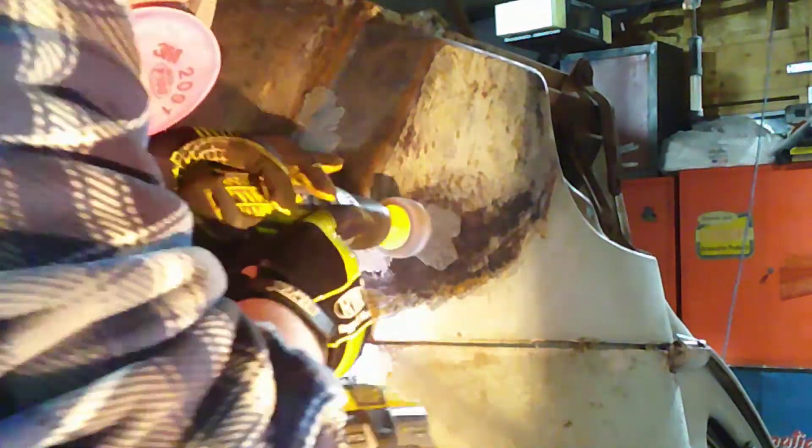Right here I'm trying to smooth things out and bring it down to a nice level where it's still bonded to the steel. Of course I'm not going to get to the original thickness of the steel — that would take a lot more time. I'm pretty happy with the way it turned out after all the sanding — you can already tell it's blending a lot better and finished up pretty nice. I did try a different brand of the similar product — I think I started with Permatex Steel Weld and then used Quick Steel or something. They're very similar products; I think I like the second one better.